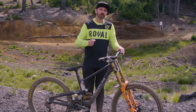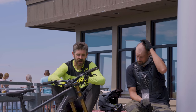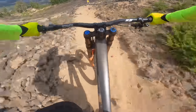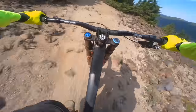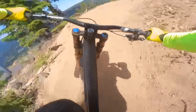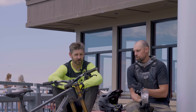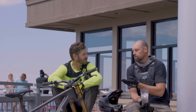Now that we've got a few laps on the bike and learned some more about Crestline, let's talk some details. What were a couple of the key factors you guys really wanted to have on this bike? The main things we were really focused on is the head tube being a one and a half inch straight head tube. So you can basically get plus or minus 10 mils of reach with specific headsets. If you go all the way to 10, you do have to run an EC — an external cup. But you can get about plus six with an internal zero-stack cup.